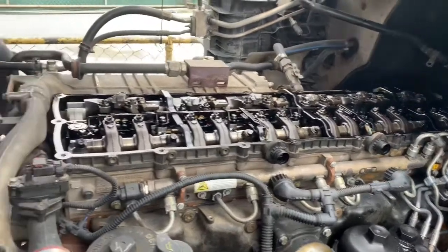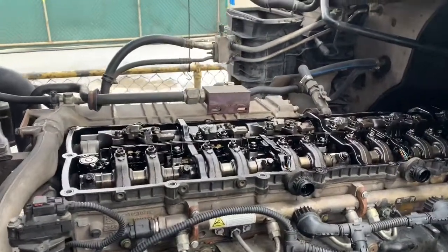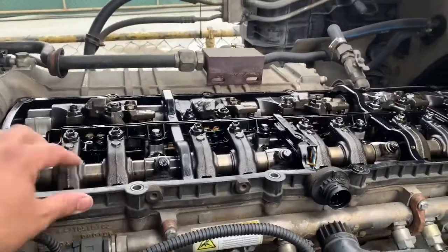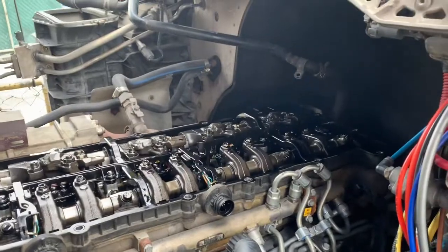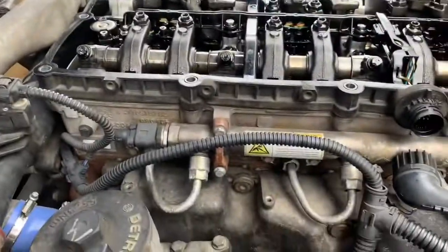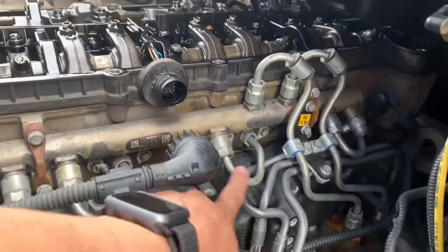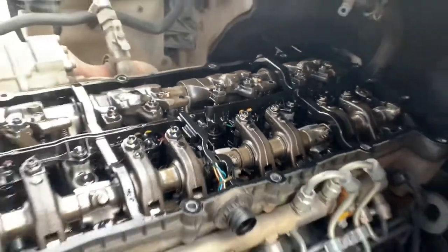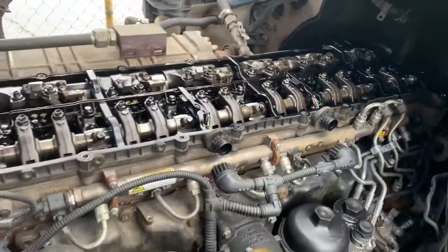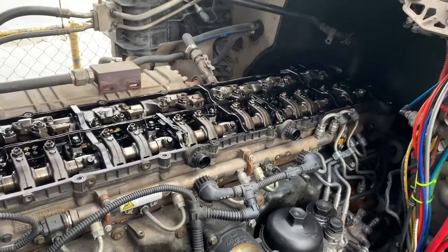I want to give you a quick overview. The valve cover has been removed and this is what sits on top, which is going to be your injector harness. All this that goes around the perimeter is your harness. And for number five, you're going to count the tubes: one, two, three, four, five. You're going to remove the injector tube and then pull out the injector. But before we do that, we need to remove the harness — it's a pretty big harness that goes all the way around the rocker housing.